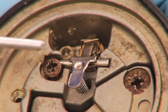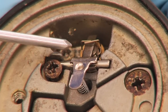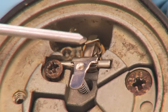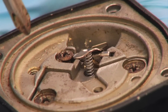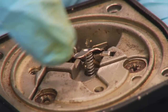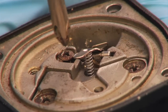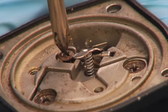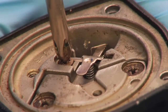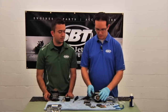Now we're going to put the arm lever in. When we put the arm lever in, we want to make sure that we're underneath the needle's retention spring. Then we're going to screw down the arm lever and make sure that the pop-off pressure spring is centered. The arm lever has a divot where the pop-off pressure spring fits into. So now we're going to screw it down now that we know it's in place. Then we're going to flip it over and do our fuel pump side.